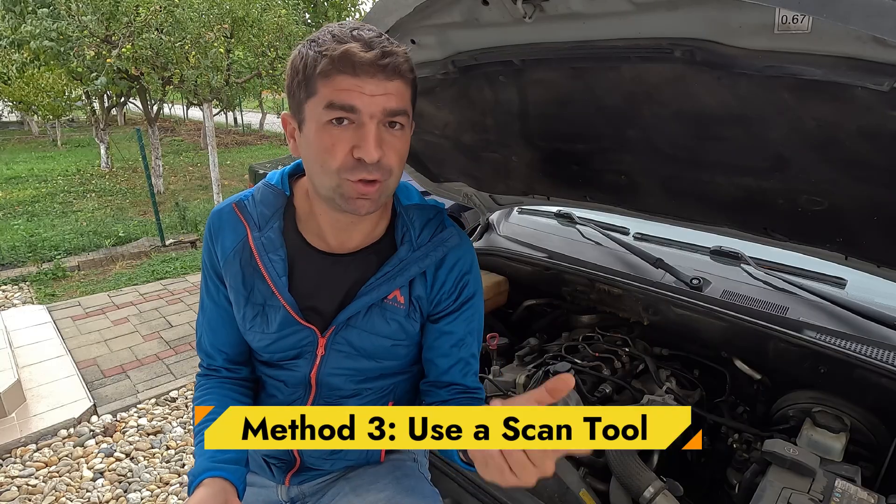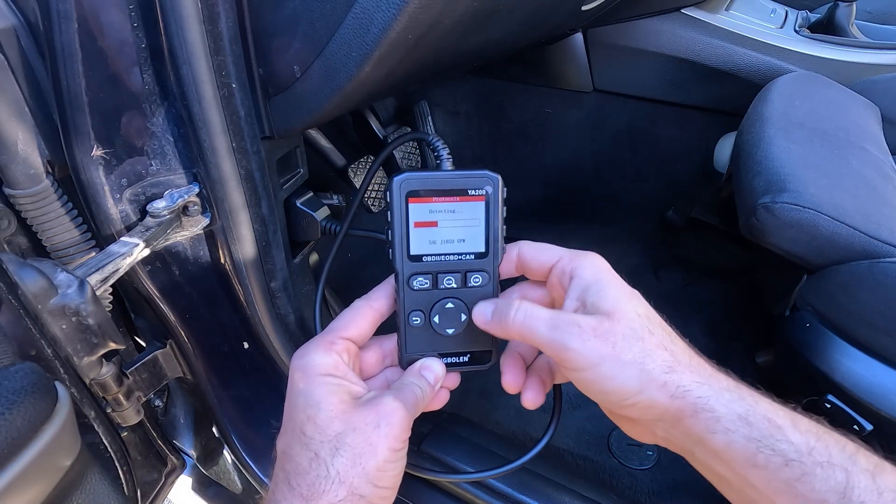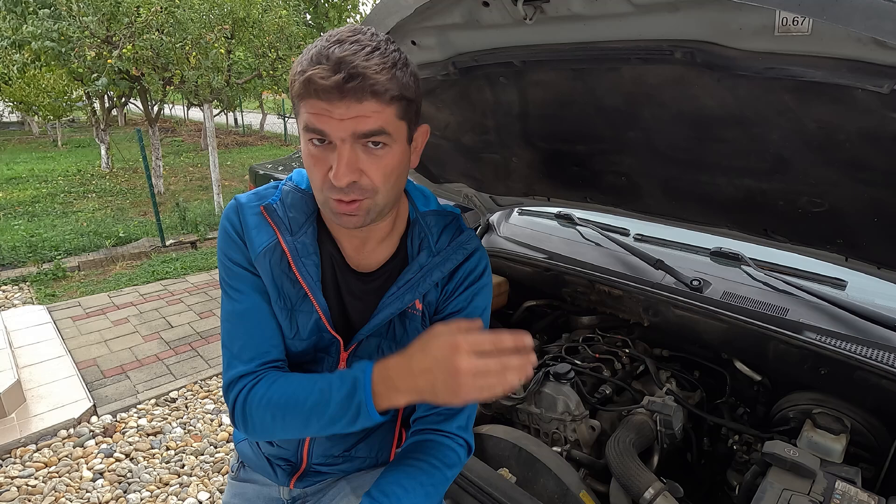On the other hand, if your car is a bit newer, it's more likely that it has an electronic EGR valve, and to test it you'll need a diagnostic tool. Plug it in and check the codes — in case of a malfunctioning EGR valve, you might see related fault codes. Not enough flow or too much of it usually means the valve is clogged or stuck, so it doesn't open or close as it should. Circuit malfunctions are usually caused either by wiring issues or by a fried solenoid inside the EGR valve.